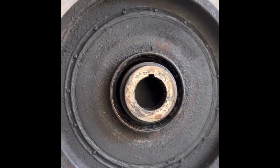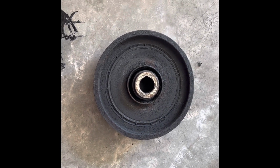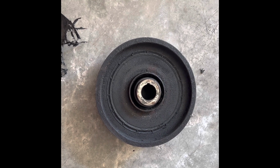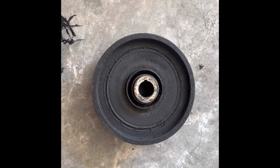But yeah, so whenever you're doing these, your timing belt, anything where you need to take this crank pulley off, make sure that you torque it down to 118 foot-pounds, and make sure you have your pin to put back in the alignment tool. That helps keep everything together, and the right torque helps keep this thing on. Hopefully you won't have any more issues.